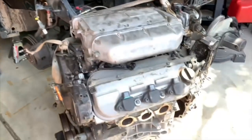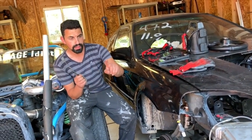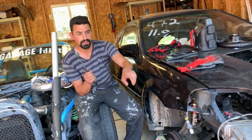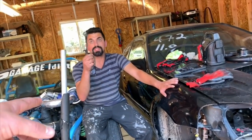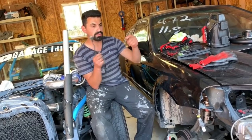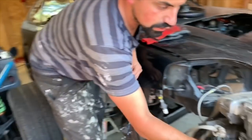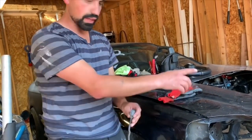So when is this going in? I got to switch this sensor and then take the timing belt, cam, and crank off. You have to take the timing belt off to do this sensor. While that's off, I'll take the cam gear off and do the cam angle sensor, because they both need different plugs. Remember, this is four wires, the other one's six. Okay. So change those and then...